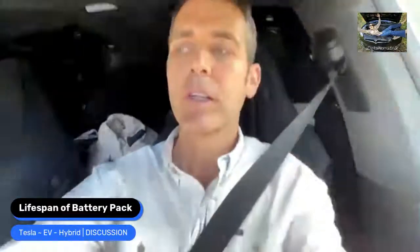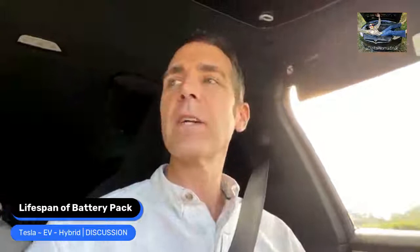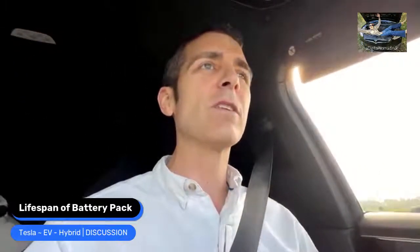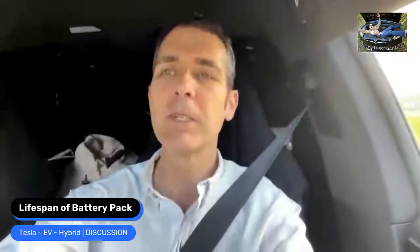So the bottom line is, make sure you use good charging techniques. Make sure that you also let your battery cycle. It likes to be cycled. It doesn't like to be static all the time. It doesn't like to be drained out. It doesn't like to be full. It likes to be kind of in the middle. And don't charge it when you don't need to. Don't leave it plugged in when you don't need to.